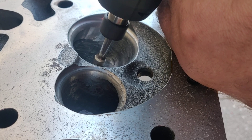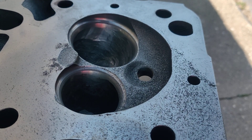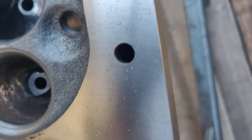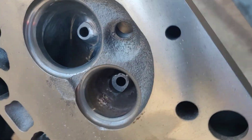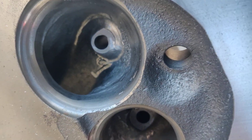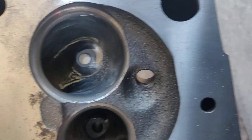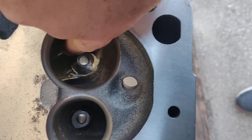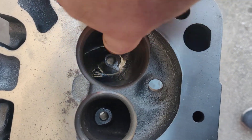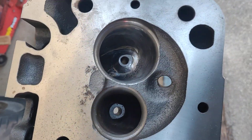I'm probably within a quarter inch of that seat right now. Let me give you a better look. If you can see, I'm just kind of taking it — I'd already started in on the short turn a little bit right here. You'll see that lip and then you see the new lip I'm making above it, and I'll just transition them nice and easy and make it flow right around. I found there's a little excess metal so I can raise this port a bit here, because it's more of a choke point at this turn — at the short turn. Since I want to raise the port anyway, I need this all to come up with it and make a nice transition out, and then it'll flow a lot better.